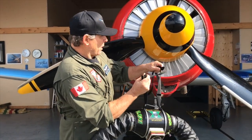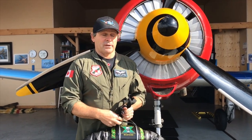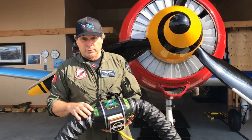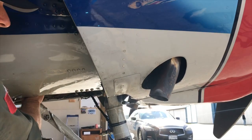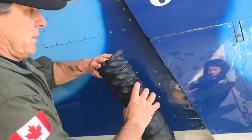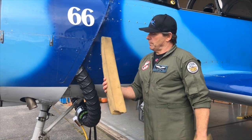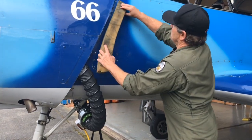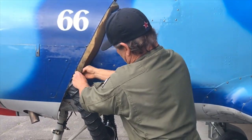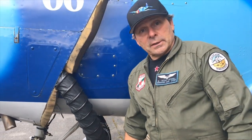Generally, this thing is made to hang from the prop and feed through the front of the cowl. But of course, like everything else in the Nanchang, we're going to reverse engineer it — like our prop going backwards. It's got blow and suck. It clips in quite easily here on the front jack stay of the nose gear, and this feeds in here — that's the blow portion which blows the hot air in and it's circulating. Once you get the heating tubes in from the Aerotherm, what I found handy is to do some insulation. Go grab yourself three-inch foam and cut little crescents out of them — you can get those at foam stores, upholstery shops, or even a camping store. You want to stick these up in here, top and bottom. I made one long and one short, and those go in there, plug the unit in, and you're off to the races.